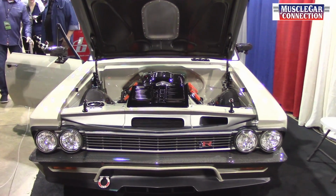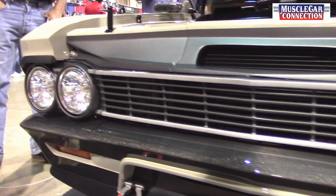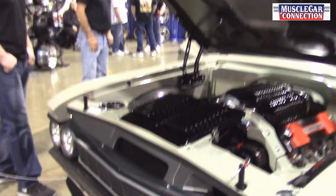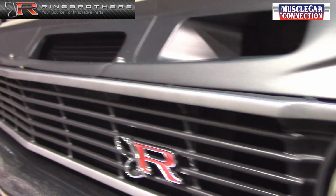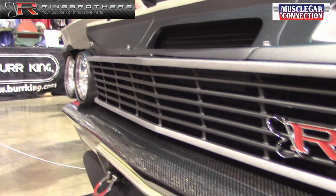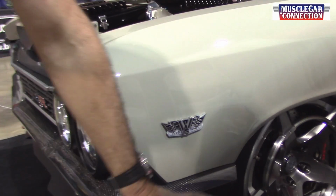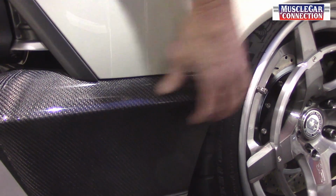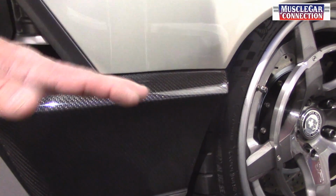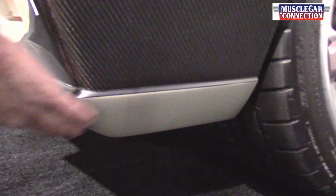All right, let me get the front of Recoil with Mike here. I mean, where to start? I'll just let Mike roll with it. We wanted a grill... the grill's a hard thing for us to change. We always want it to look recognizable what year, so we try not to mess with that part. But we did build a bumper from scratch, which then changes the grill, because there's normally a molding underneath and the trim actually comes around. Since we made the bumper, we whacked off the front of the fenders and made the bumper really make the wheel opening. Normally the bumpers only come to about here, and then the fender kind of fills in. So we whacked that off and made the bumper create the whole finished look, which allowed us to make it a little deeper, bring in again the paint.